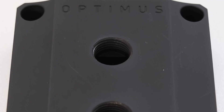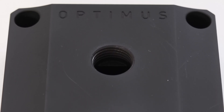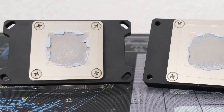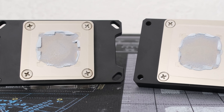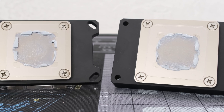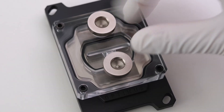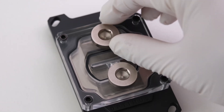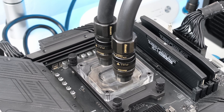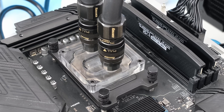So while the Signature V3 does achieve a cooler CPU temperature, it is only by one degree Celsius for these specific tests. Shown on screen are the actual paste and contact shots for each of the water blocks — the Foundation on the left and the Signature V3 on the right. Keep in mind, Optimus used the Ryzen 9 7950X, a 16-core processor overclocked to 5 GHz, resulting in approximately 250 watts — more than double the 120 watts of the 7800X 3D. Perhaps the block will show more significant differences at those higher wattages and workloads.